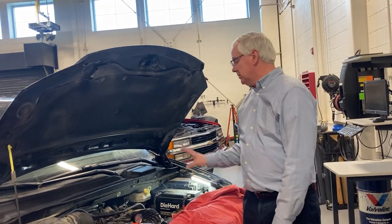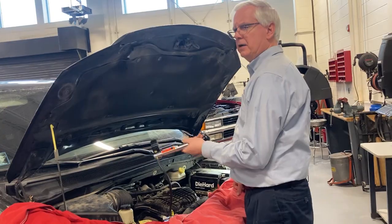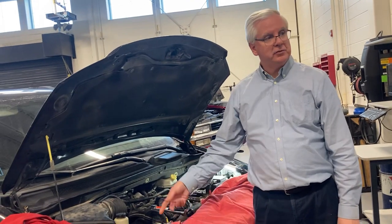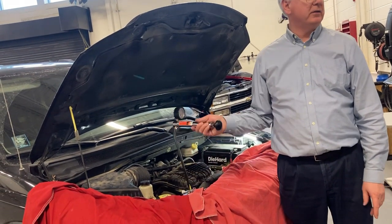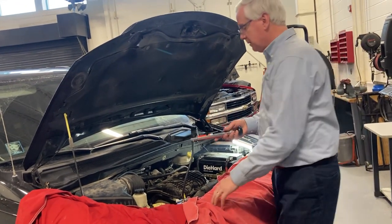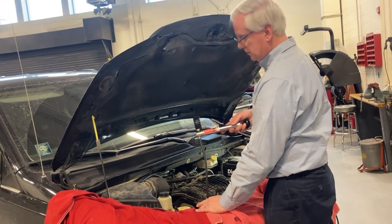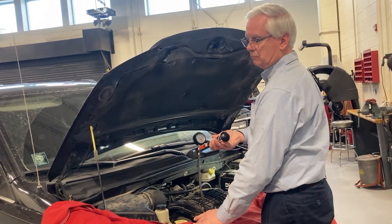So he's had this on pressure. It's at 15-ish pounds, 15 and a quarter. So that's probably good. We need to take this off. When we go to take this cap off, do we just go counterclockwise, or what did I teach you about getting this pressure tester off without getting antifreeze all over you? Clockwise, on the little cams here. Hold this up so it doesn't get any antifreeze in there. Take your cams, go clockwise, let the air out, and watch the gauge. If you go too fast, it's still going to get coolant on the floor.